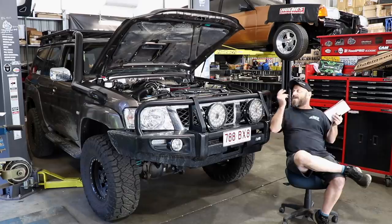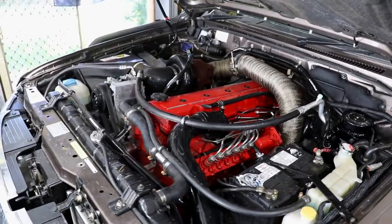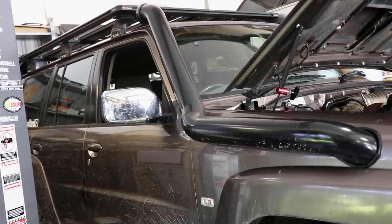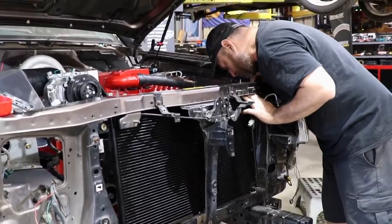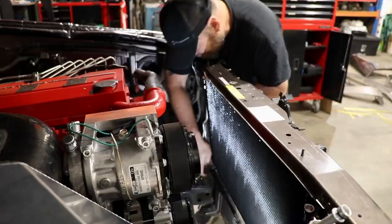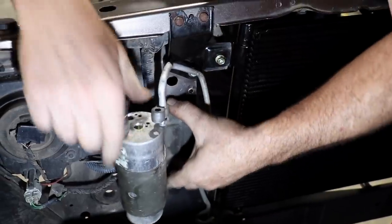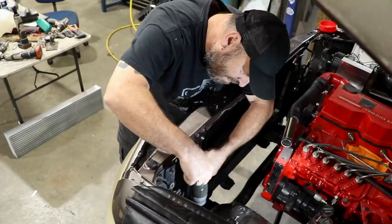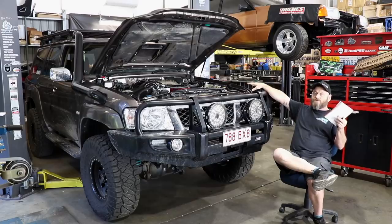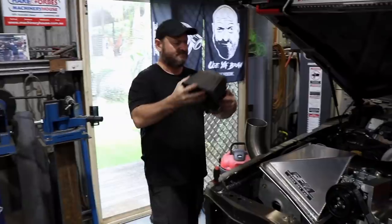Space - again, big engine takes up space and everything's on the wrong side of the car. So we've changed the battery to the other side, changed the snorkel, changed the air box - everything is around the wrong way. You do have to use a bit of creative engineering to get around that. We've flipped things over and modified brackets, turned the condenser around, just to make it neater so there's not pipes running back and forward. That just requires you to stand back, think, and be more creative instead of just taking the straightest path. Whatever airbox you've got for a TD42 is not going to be big enough - that's one of the big reasons we did what we did.